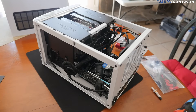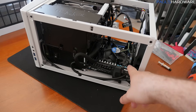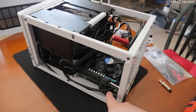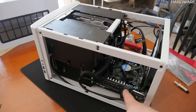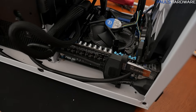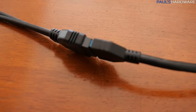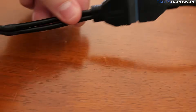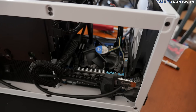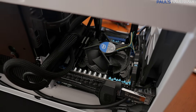I got the drives all wired up and wanted to do one last once-over of the hardware. I wanted to keep the OS USB drive internal rather than sticking out the back, but I didn't have a simple USB 2.0 internal bracket header. I had to use a workaround: a USB 3.0 header with an adapter that goes USB 3.0 to USB 2.0 — a bit of a waste of a USB 3.0 header, but I had three of those and none of the USB 2.0 brackets.